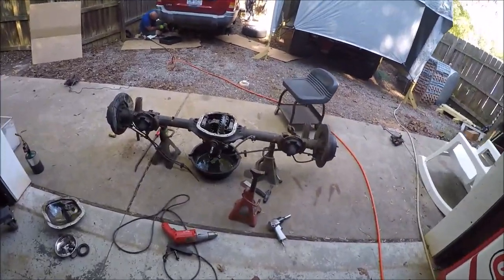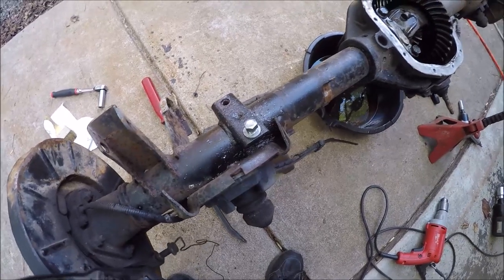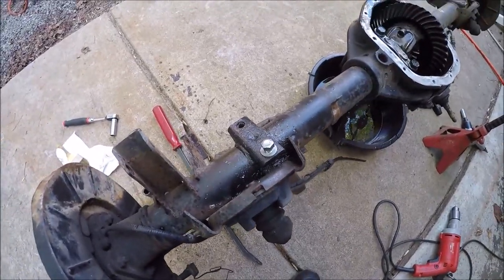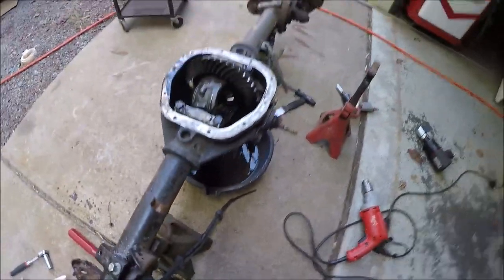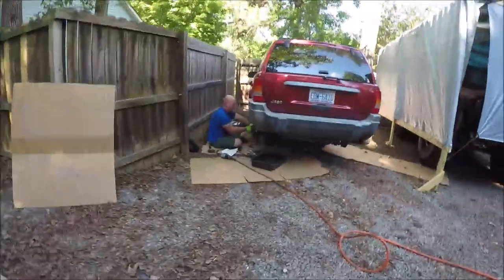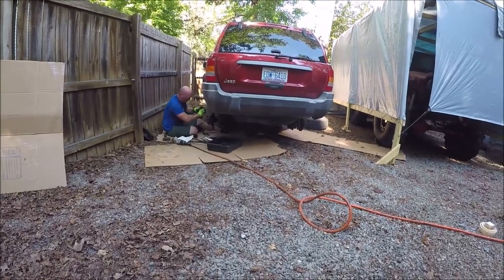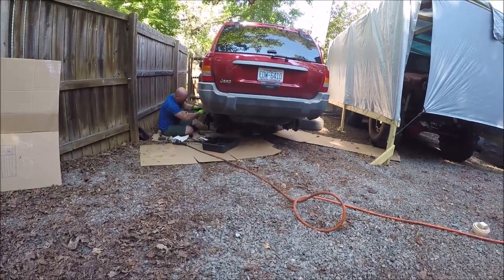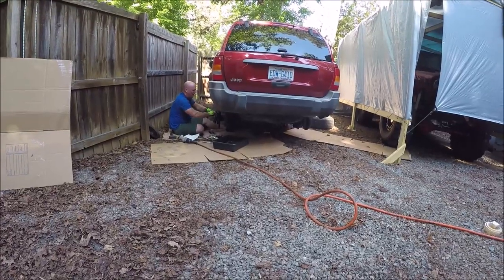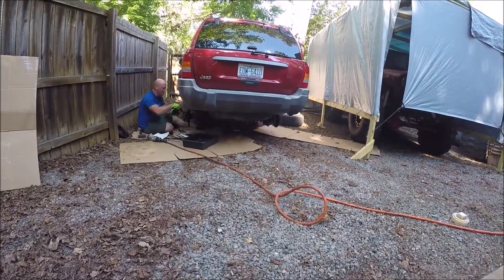Update here: had to drill out a broken bolt. Tried left-handed drill bits, still wouldn't budge. A little bit of heat, and eventually just had to drill the whole thing out and re-tap it. Anyway, I've got this axle about ready to go — got to swap out the brakes, and then Brad has been over there working diligently. We're about ready to drop that axle. We're making progress; I haven't bothered to film every little thing because it's just basic auto mechanic stuff — didn't want to bore you with it.